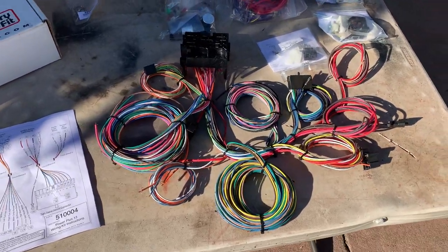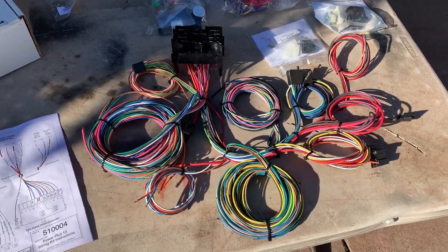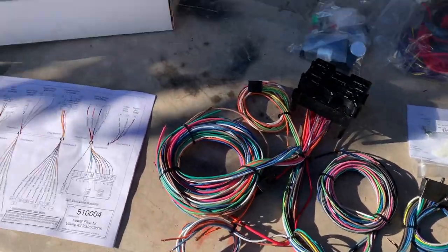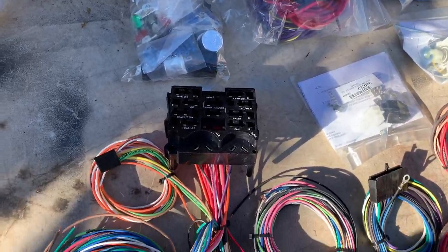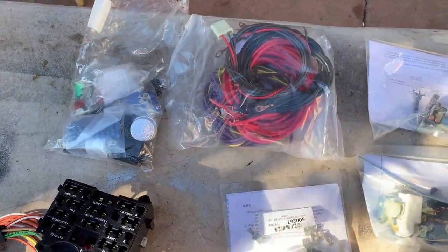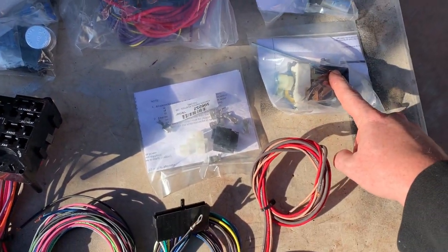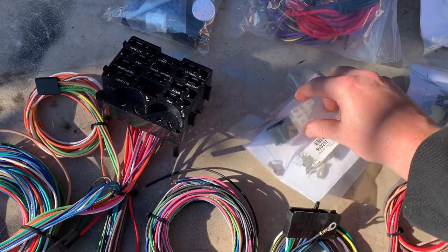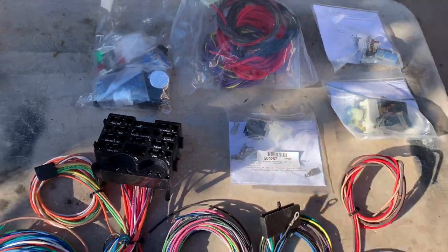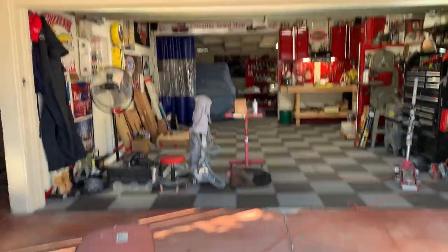Got the full harness here. We're upgrading it — not going to the old school glass fuses. So we got a nice kit from Autowire. You've got the main harness, 13 circuits, and we got the alternator and starter. Got the high beam switch, the headlight switch, and there's even a thing here for the ignition switch — don't think we'll use that though because ours is a little different setup. First things first, we've got to mount it up against the firewall near the steering column and then start deciphering all this wire and start running it.